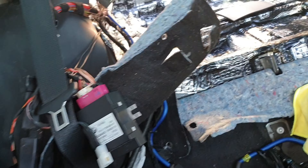The back should now be loose, and now we need to get the T20 screws out at the front. Once those are out, the whole console should just lift out from the back and slide out — and there you go, one console out of the car. That gives a lot more room to work and you won't end up scratching the console while working in the back.